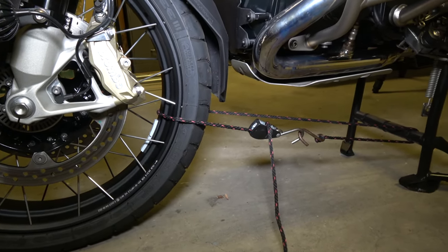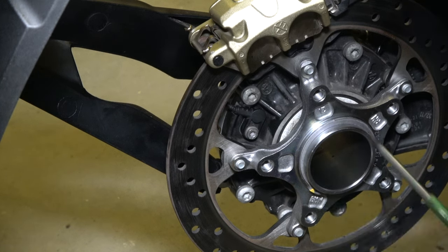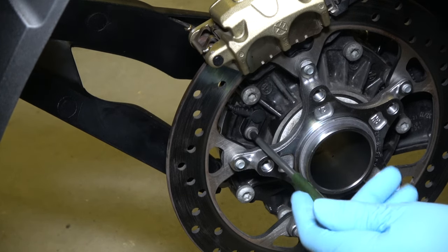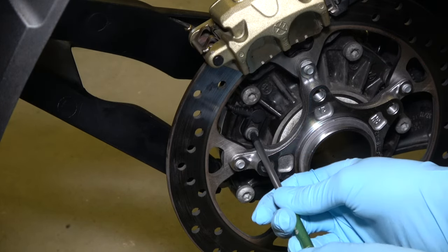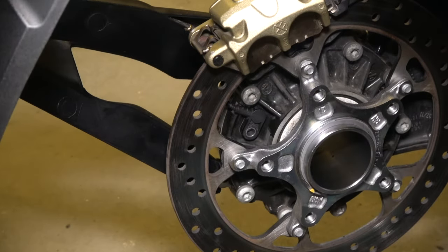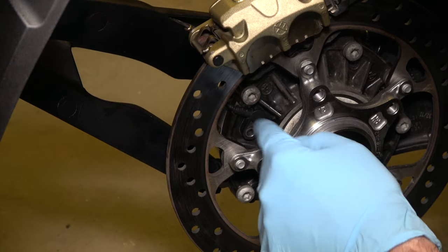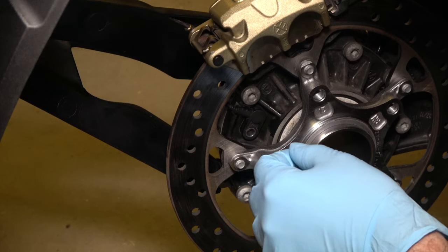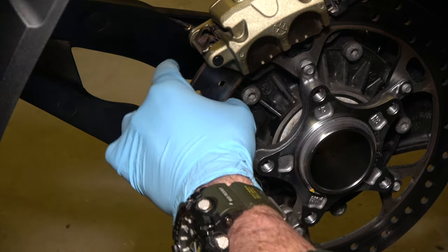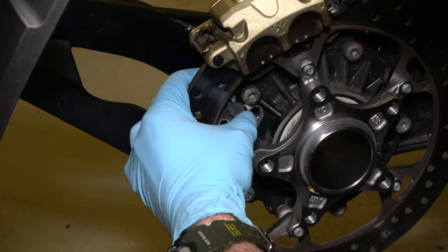I've removed the rear wheel to make life easier. The bolts that hold the wheel on are T50s, so make sure you've got a tool for that. We're also going to remove the speed sensor — it sits right there and feeds information back to the computer for the ABS. That's a T30 bolt. Now, if you're going to change the diff oil I suggest doing it at this point, but I'm not because I've recently done an oil change on the final drive. So I've made up a little plug with a screw in the back of it — you could use a piece of dowel — and I'm going to push that into the hole so when the final drive drops down, it stops the oil from running out.